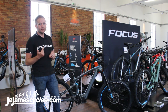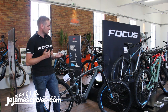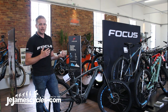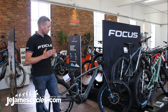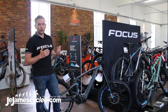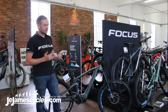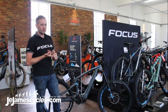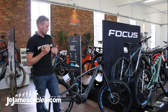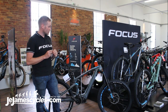And also the way the Shimano system feeds power in, we feel is the best option for an e-product. Shimano's the first dedicated mountain bike trail system. It's not an adapted e-bike system. In trail mode, it feeds power in based roughly on your power output, so it's a much more intuitive product for riding off-road. There's no lag on the system, so you don't get any of that weird kind of over pedal that you get on some other systems. It feels just like riding your bike essentially. So yes, that's what we do with that.